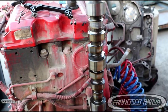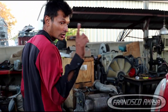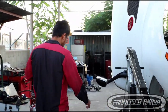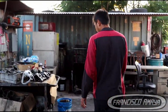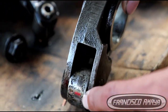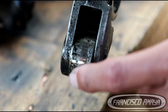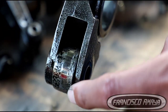The engine is not going to work properly because we have a tolerance reduction because of the wear here. Also, this damage is going to be present on the rocker arms of this engine, which are over there. This is the rocker arm that suffers the damage, and you can see how this one looks — all this damage. This is the reason why we have that kind of damage.